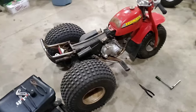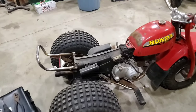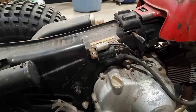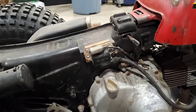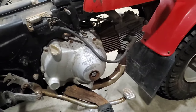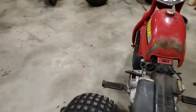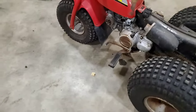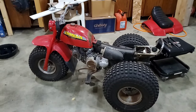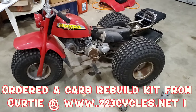All right. Well, that was a neat little exercise. So we swapped the coil out. The old coil is gone. I had a little issue here with a bolt that the Phillips head had stripped out on, so it was kind of timely that I mentioned that. But it only took a couple pulls, and it almost idled all on its own. So, obviously needs a little bit of a carb cleanup, since we got a little drippage on the floor there. So probably the needle valve seat is just a little bit dirty. So, we'll pull the carb before we commit to putting this all back together.